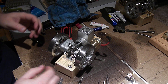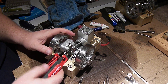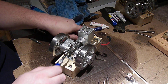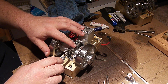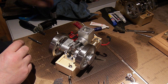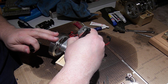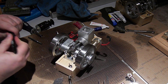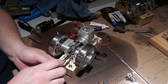The way to get the piston out of these is to take the whole liner out, so I'm going to take the big end off. A little bit of oil is going to take that Sharpie right off later when we run this, so I'll get this marked really well.